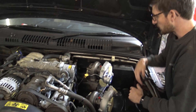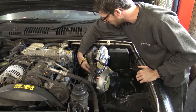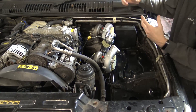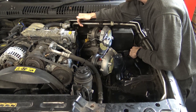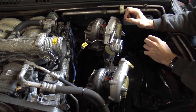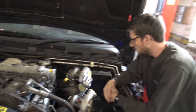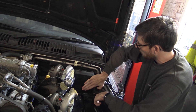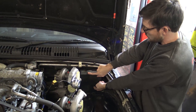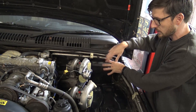Very difficult to actually get enough space in here. This turbo I can't push further forwards because the manifold to it would then hit the suspension mount, and I can't push it that way anymore because the downpipe needs clearance for the rocker cover and the HT leads. Obviously the HT leads can be heat shielded — we've got some nice heat shield socks for those actually — and the downpipe can be wrapped or ceramically coated. So that's a nice setup there. Obviously it looks nice and symmetrical as well. This ECU is close to here, but again I've got a plan — this box could be trimmed and pushed back a bit, or the ECU could actually be mounted up the other way inside of it potentially, which would then lower everything, and again a heat shield between them. So that's less of a concern for me at the moment.